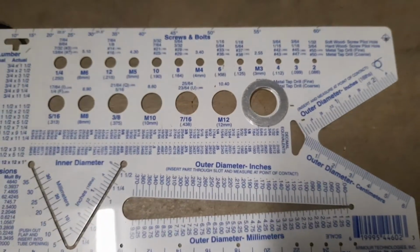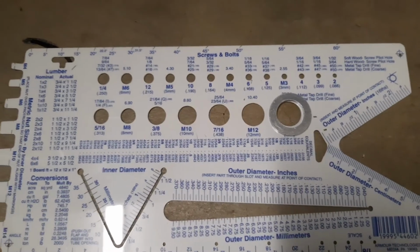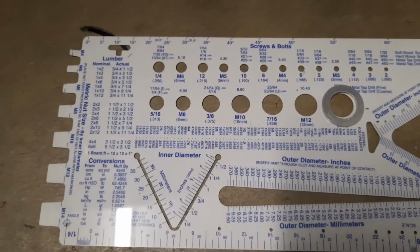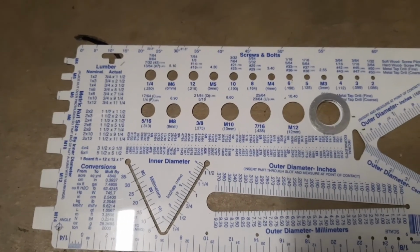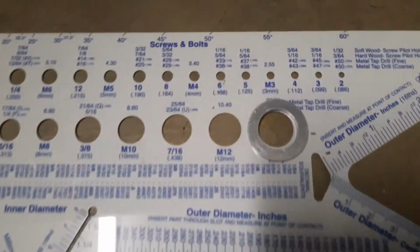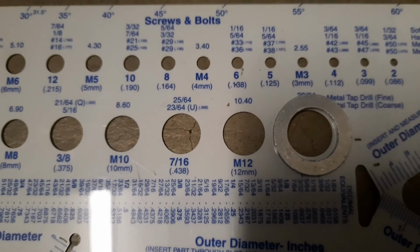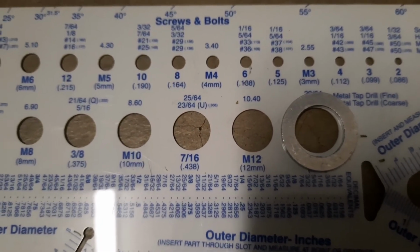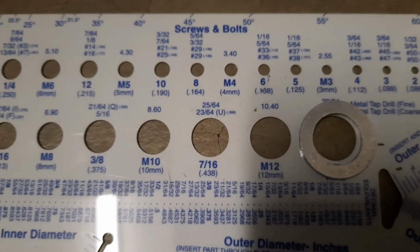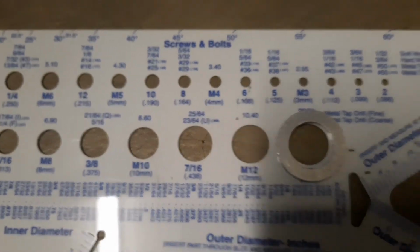So it's 14 for the oil pan. It's 18 for the transmission bolt. And sometimes it's really hard to get that crush washer off the transmission bolt because it's on there super tight. And I have to admit, I don't change the oil pan every time, although that comes off a lot easier. So the main idea is that you don't turn it over and use the other side because it's been shaped to fit, as you tighten it with your torque wrench.